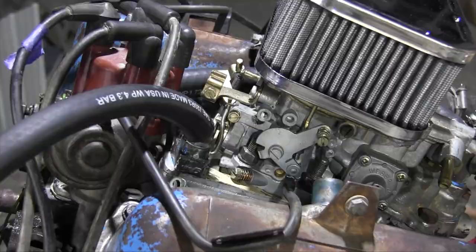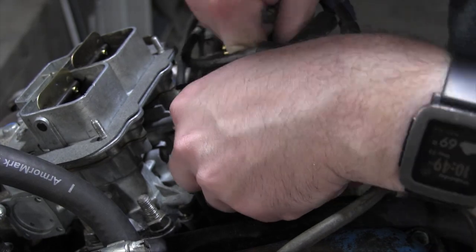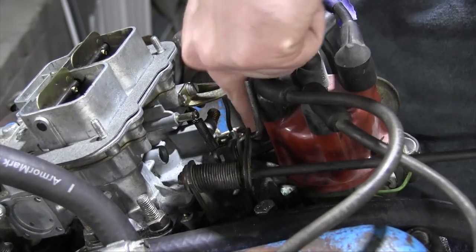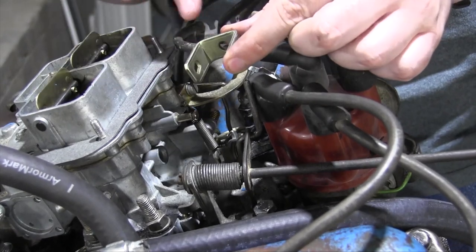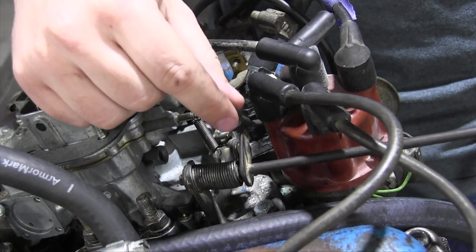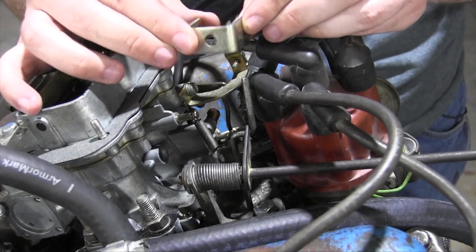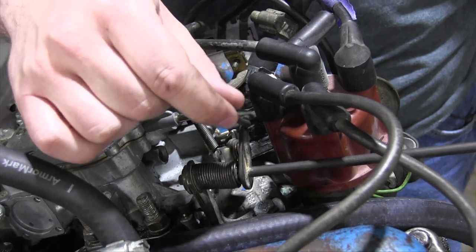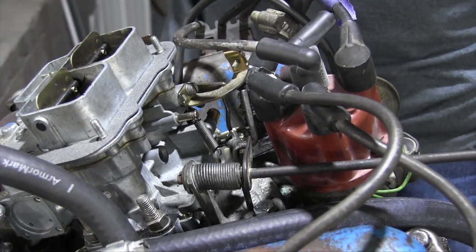So that's cool. Just about the last thing I have on the carburetor to cobble together, or indeed this entire project, is the throttle linkage to the carburetor. On the back of the carburetor, there's a little bolt here with slots in it, and this is the old throttle linkage that I had to take off because it fouled on the distributor. It's just a simple twisting mechanism. A cable would have been a much easier solution, but anyway, I just need to figure out some way to modify this guy so that this little slip rod that pulls on the twist arm fits onto it, and I can control the speed of the engine, because that's always a nice feature to have.